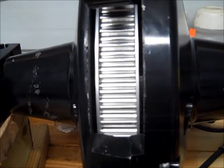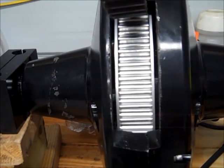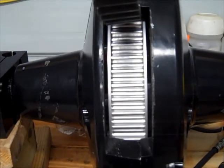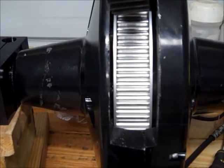Now once you have it totally apart, you take that center part with the pulley off of there and you're going to see roller bearings on both sides. Now you're going to have to pack those roller bearings with high temperature grease. Take your time, make sure they're filled really well, use good grease. It's not that difficult. Then on the end of it, where the roller bearings are attached, inside of that drum is the gears. You also need to pack the gears full too. So on one end or the other, you just keep pushing gear grease down inside until it's packed all the way through.